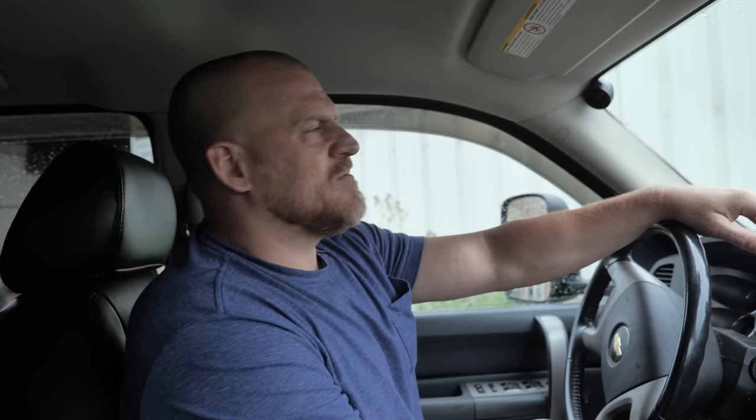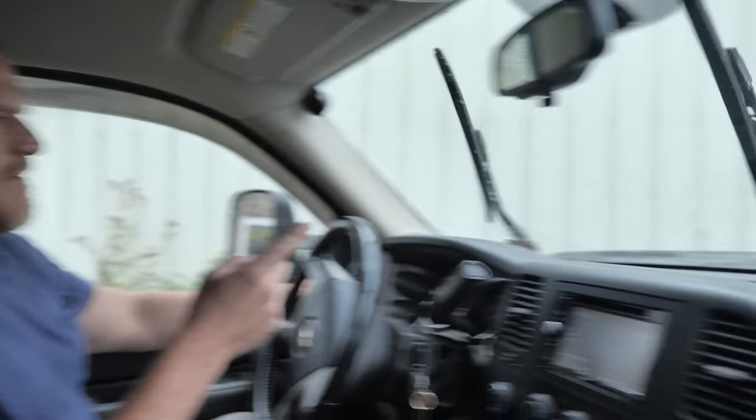Hey guys, we're back at my brother's shop today. We are working on a Jeep that has a misfire. From what my brother told me, one of the injectors is not firing and he's got some oxygen sensor codes too. On a side note, I had a wiper motor problem on my truck - when I turned my wipers on the lights would dim, so there was a massive amount of current. I thought the motor was frozen, but all my linkage was frozen - it never needed a motor. I returned it. Cost me nothing.